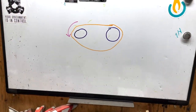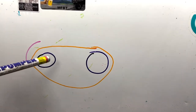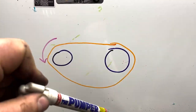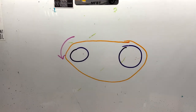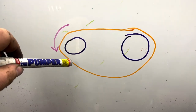To understand how this works, I'm going to go over the theory with you. On my whiteboard I drew a diagram - in your transfer case there are two gears with the chain. It doesn't matter if you're going forward or reverse: one side of the chain is going to be loaded and one side is going to be unloaded. The top side will be tight, and the bottom is where all the slack is.